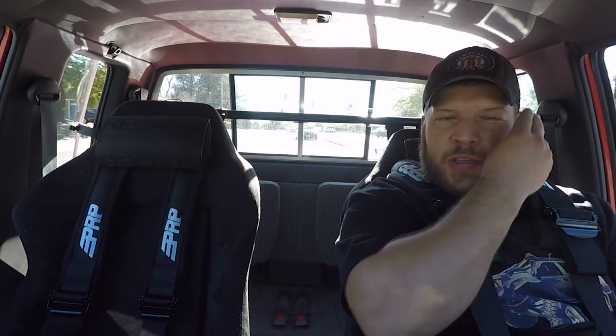Alright, so she's all warm. And we got a red light. And it's still putting out 8 to 9 PSI. That was 7 pounds. Probably about 4,000 RPM. Definitely smoother. Doesn't bog off the line. Doesn't kind of fall on its face a little bit. That was only 10 PSI and this thing's just can't wait. 30 PSI. 32 pounds is the goal.